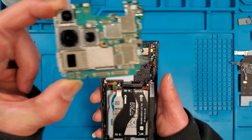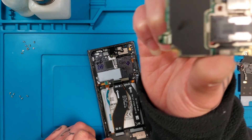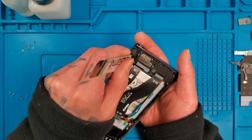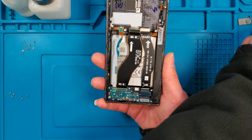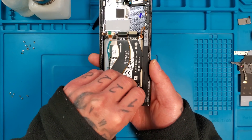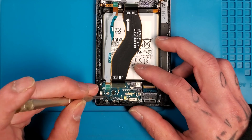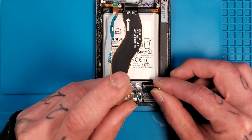And that's it — got the motherboard right there, guys. Three or four cameras on it — solid looking motherboard. We'll go ahead and take out the bottom speaker, just try to get a finer spot. They'll come right off and expose the charger port. We'll unplug this LCD cable and get that out of the way, then move down and take out the three screws holding down the charger port, along with all the other cables connected to it.